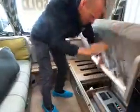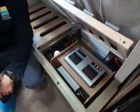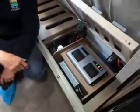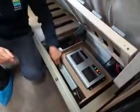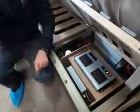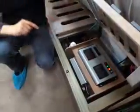No, there's an isolator button here, look. If that's not switched on, you will not be operating the heating when you connect the electric on the outside. Yes, it will run 240. But if it's 12 volts, it runs through this charger, supplies your battery, and then it draws 12 volts off. If it works off 240, that will go direct to your boiler, which is there.